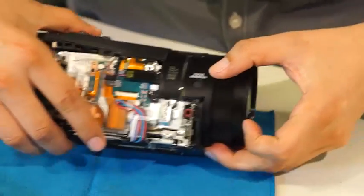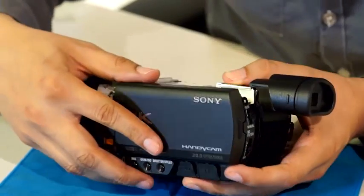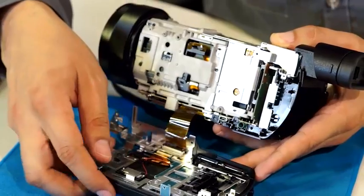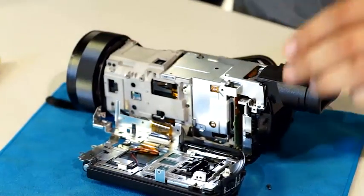The cover of the lens is then removed, designed in several pieces so parts can be easily replaced if needed. The zoom and auto control pieces are then removed, allowing for the 3.5-inch extra fine LCD touch screen display to be completely disconnected. The ribbon cable is the main communication link the screens and buttons on that side used to talk to the rest of the camera.